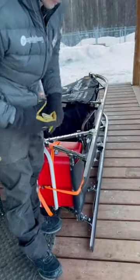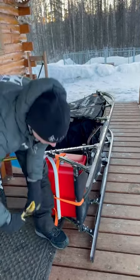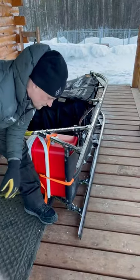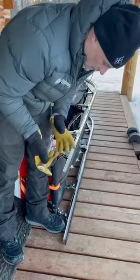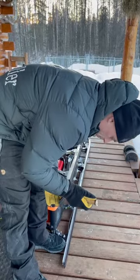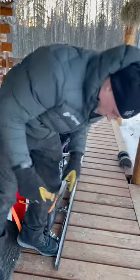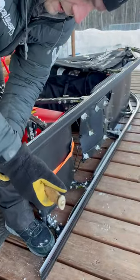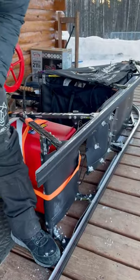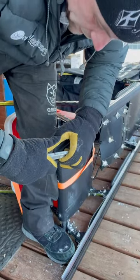Last step. The tail comes past the aluminum by about three inches or so, but I want more like five-eighths to three-quarters of an inch. This plastic is really tough stuff, but if you score it, you can break it pretty easily. I'm going to take my knife and carefully get a good deep score mark right there. Now I'm going to open that score mark just a little bit — it doesn't take much — and then I should just be able to pop that right off. Then we're going to clean that edge up and take that sharp edge off the end.